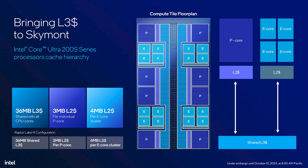There are also new details about the cores themselves. The layout of the compute tile has changed — the E-cores are now intermingled with the P-cores, which Intel says helps with hot spots and heat dissipation. By spreading the hot P-cores around and putting the E-cores in the middle, you should get more even temperatures and fewer hot spots. The big architectural change is that the L3 cache is now shared not only between all the P-cores, but the E-core clusters too, which should help speed up core-to-core task switching that these hybrid chips do a lot. There's also an L2 cache bump, especially on the P-cores, from 2MB to 3MB per core — nowhere near AMD's 3D V-Cache levels, but more does seem to be more better.